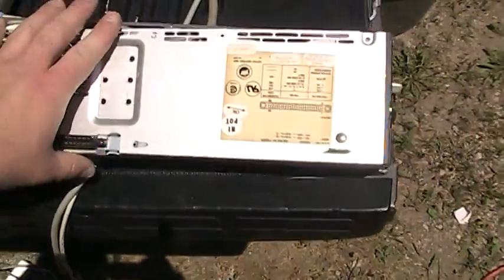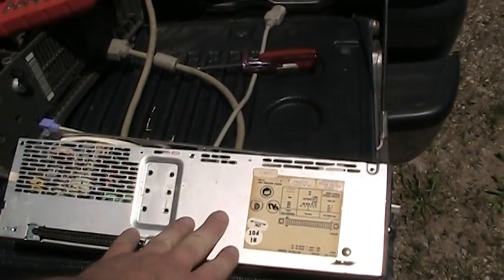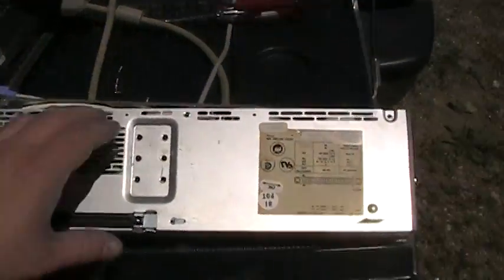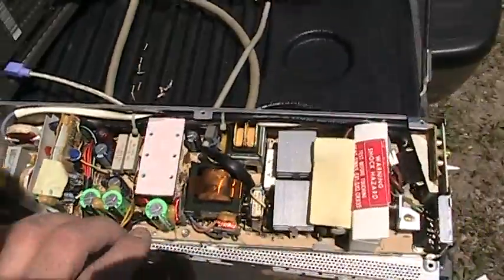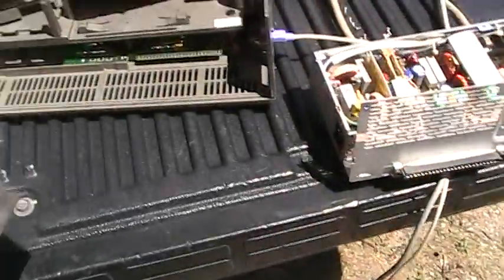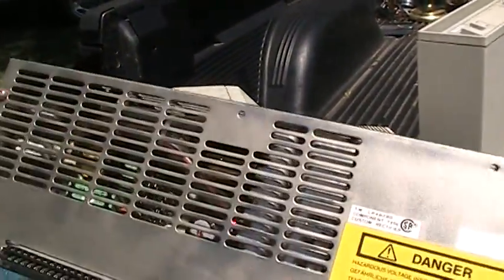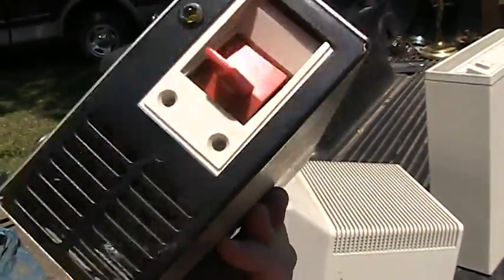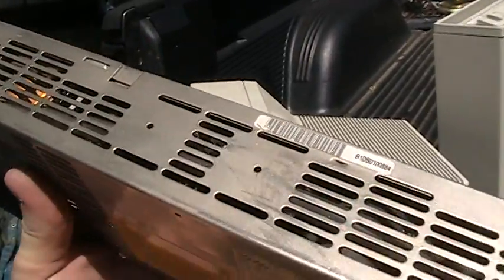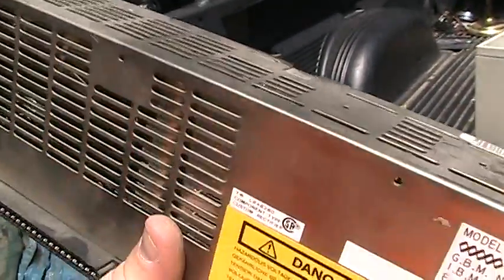This particular power supply — I've seen these from two different manufacturers in the PS2's Model 50 and 70. This one was manufactured by Zenith Radio in Mexico. They really manufactured computer parts and for a while even computers of their own, although rather interestingly they didn't put their brand name anywhere on this. Sometimes it shows up on the circuit board in the Model 80 power supply, but for the most part these are anonymous. The other manufacturer of these power supplies is Aztec Custom Power, which is a division of Emerson Network Power these days. I think the Aztec unit is actually a little bit better made. Plus, at least at some point, you could actually hire Aztec to repair these — they had a service where you could ship these in, and while they wouldn't provide schematics, they would repair any power supply that they had manufactured. Probably not cheap — I never tried to have it done, but at least it was an option.